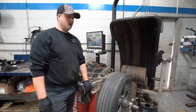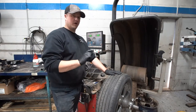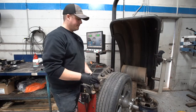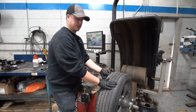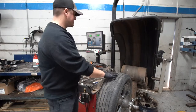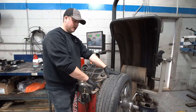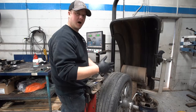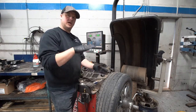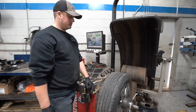Another thing this machine does is what they call road force balancing — usually with bigger wheels, mostly trucks. When you've got 19 or 20 inch wheels on trucks with very aggressive tread and 8, 10, or 12 ply tires, that heavy spot is a lot greater and you can actually see the tire moving up and down. What may have happened is the high spot in the rim and the high spot in the tire are also lined up. A big drum will come down onto the tire and as it spins it measures — it'll have us chalk line the tire, take it off the rim, and rotate the tire so the low side of the tire lines up with the high side of the rim and vice versa, reducing the variation when we put it back on the machine.